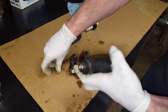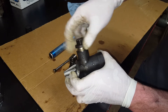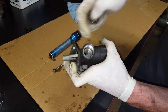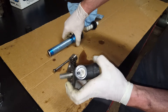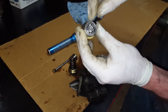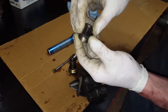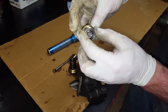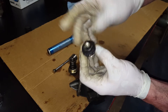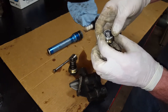Let's pop this top piece off here — this is your high-pressure outlet. There you go, there's the outlet. And, again, one-way valve. Fuel can push past this rubber flap in here — maybe nitrile, I don't know what it's actually made out of. Essentially it's a check valve that goes to the injection pump and won't allow fuel back into the fuel pump.